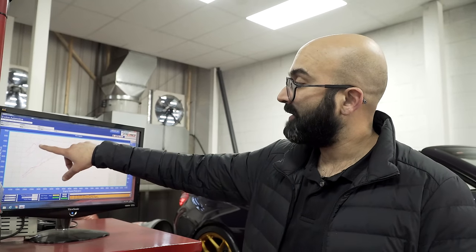And also with the torque low down, we've mapped the torque in to come in more gradually, so it would just get more traction. Overall, it's a good upgrade. Hope the customer's happy with it, and he's going to come back with 99 octane and we'll re-dyno the car and see what power it makes.